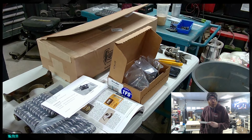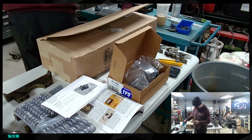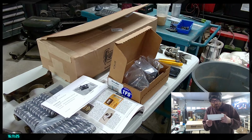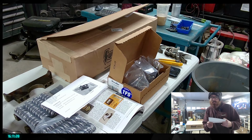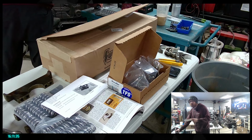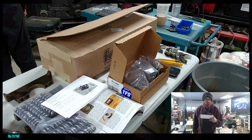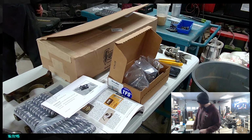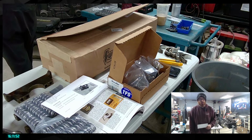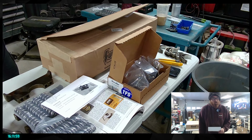So if I'm big braining the URL, I should be able to do just that. Hey, so Stage 3 Pro LS Turbo. 232 intake, 234 exhaust, yep. 115 lobe separation, yep. Plus 5 advance, yep. Other than that, yeah, that's pretty much it. So, all right, that's the proper parts. Let's go. We have everything we need here, and with that combo, let's see if I have the spring stuff. High lift.